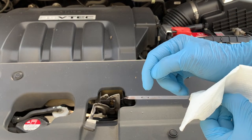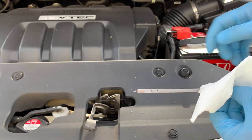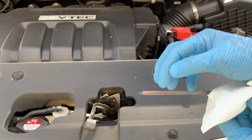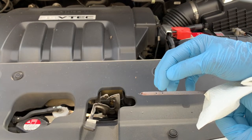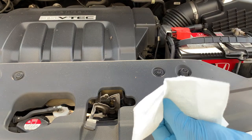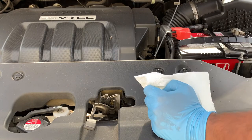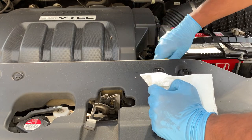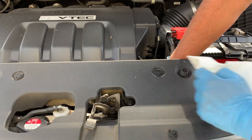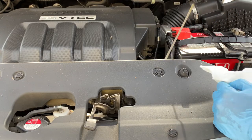My level seems to be just below the top mark. Flip the dipstick around if that provides a better visual, and make sure to check your vehicle specs on how to properly check the transmission fluid. For the vast majority it'll be while the vehicle is running or at least at hot but turned off. Some vehicles such as my F-150 have both a cold and hot reading, so you don't need to warm up the engine. I can't stress safety enough — please focus on the task at hand when working with a running or hot engine.